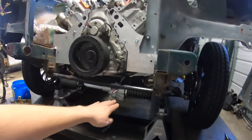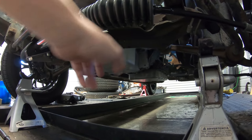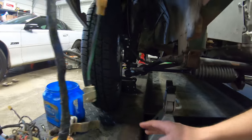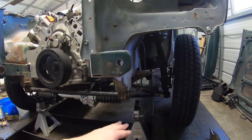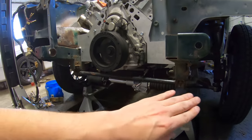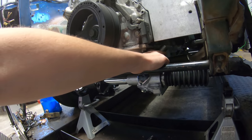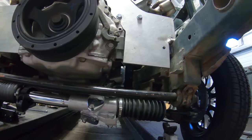I ended up getting the steering rack kind of welded up on the mounts, just tacked in. As you guys can see, it doesn't really fit too perfect, so I will probably have to make some sort of different mount or something that comes off of here, but otherwise it's on there. I have some shortened links, that's why the wheel is kicked in on both sides, but it worked out to at least see what I need so I can measure and get some longer links in here. The way it sits, the car will go lock to lock — inside it'll hit this little stop. So it's looking like it's not going to bind up too bad; I was kind of worried about that. It also looks like it's going to clear the pan just enough to reach the other steering link.